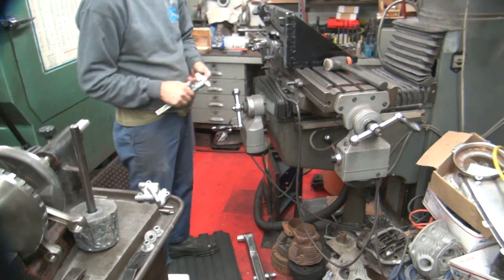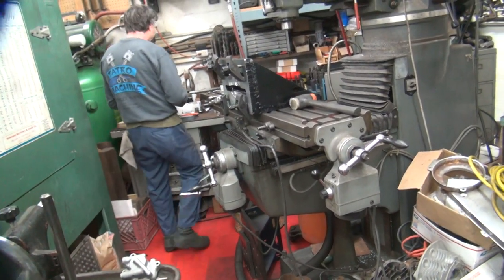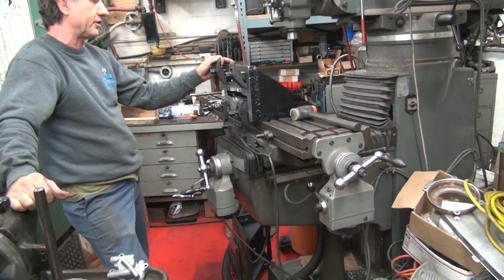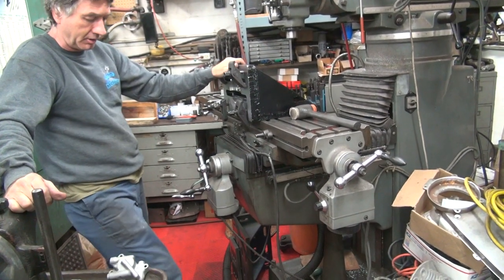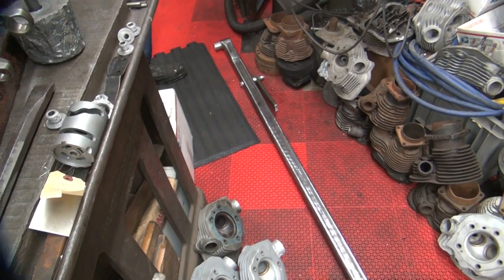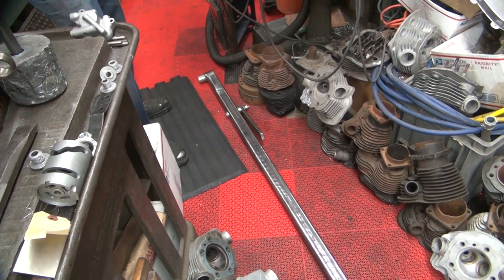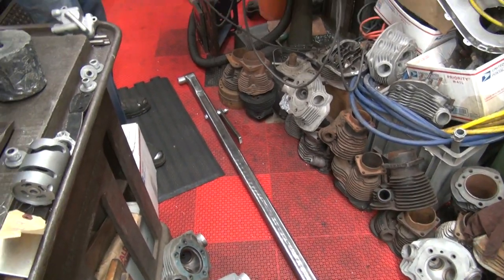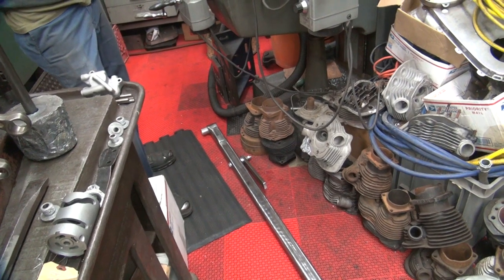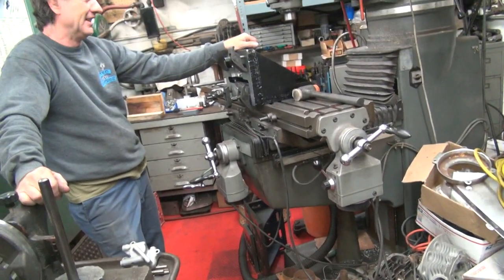That's why hydraulics don't really work — there's no feel in it. It just keeps moving, keeps trying to move. Once it moves, it keeps moving. That's why when I was pulling I was waiting on you to tell me if it was moving. You can see all of a sudden the clearance just moved right out, but you can't tell me the pressure — that's the only bad part. This bar is holding up pretty good too. That one is quarter-wall tubing we put in there now, so it doesn't flex like the eighth-wall stuff, but it's heavier. Now instead of five foot long it's eight foot long. Eight foot works but it's a little bit long for the shop. Seven and a half would fit in here a lot better. Five is too short — you could cut a foot off of it. That's it for truing that crank.